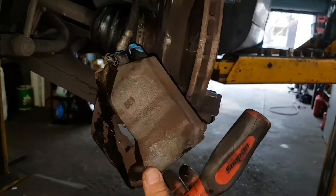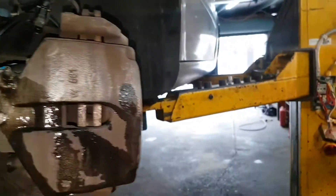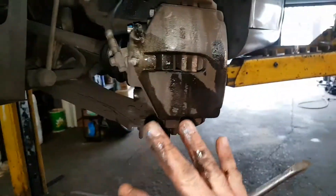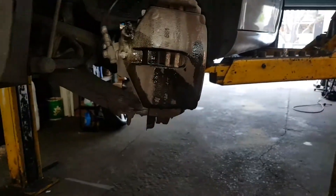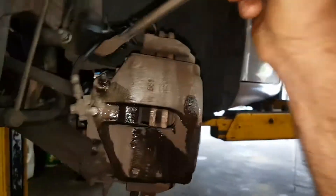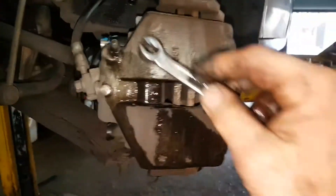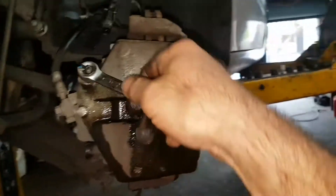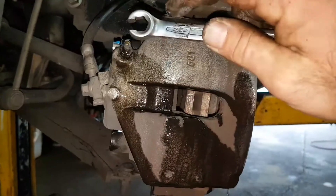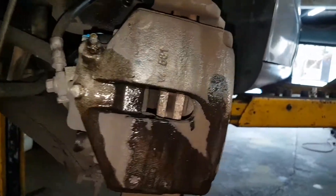Now another thing I normally don't do - I would have fully bled the caliper in its position before I continued. Being in a workshop at the moment, working alone with distractions - you don't leave this. We've all done it: you leave this, you leave brake fluid draining, and before you know it you've got air in the system. Also, you don't tip it upside down. I like to finish with it over here, so no matter who walks in, if you're draining the brake fluid, now's the time to do it. Don't leave the vehicle. Finish closing it, put the cap on it and you're done.